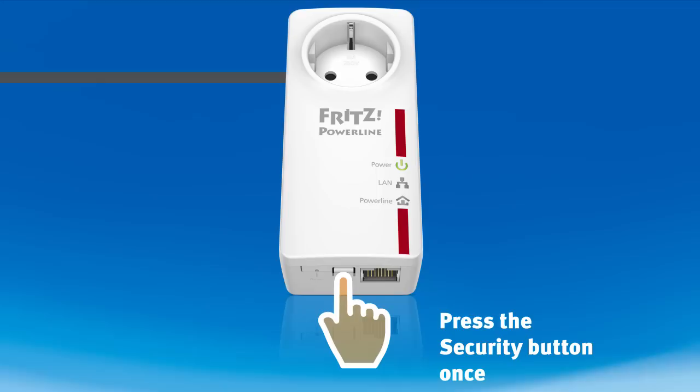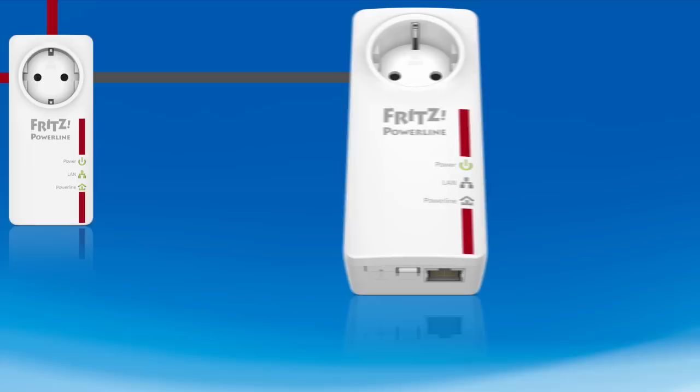Plug the new FRITZ Powerline into an outlet. Press the security button to set up a new connection. Then, within 2 minutes, press the security button on a Powerline adapter already used in your home. That's all.